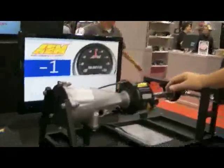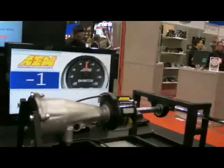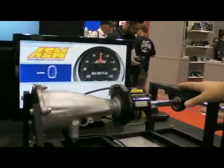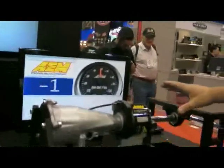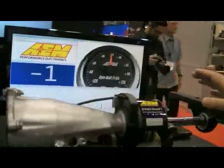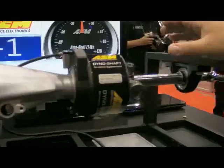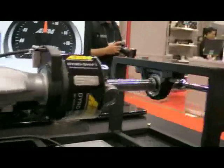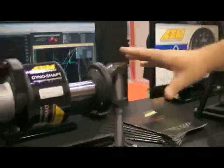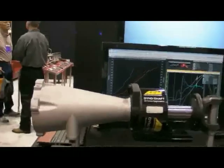This is the standard street version — the sportsman version. There's also a pro version. The real difference is the sportsman version uses a cast iron yoke, and it's meant for fairly low horsepower applications. This is not really appropriate for any kind of hard launches or big drag racing applications.